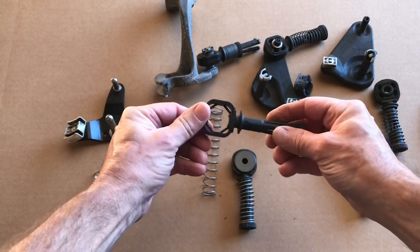Go back out to the engine compartment. Push down on the nut — there's a bit of play — then take the side-to-side cable and give it a wiggle, forcing it back towards the firewall. Let go — you don't hold it, because you don't want the cable loaded under tension or compression — you just want it as far back as it'll go. Then give that ring a turn and the spring will do the rest, locking that side-to-side cable in position. This is the most critical of the two adjustments.